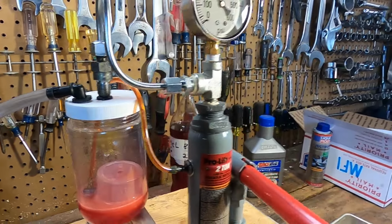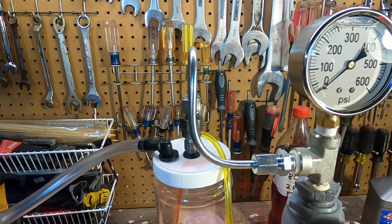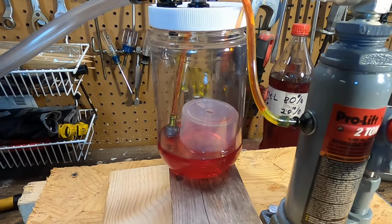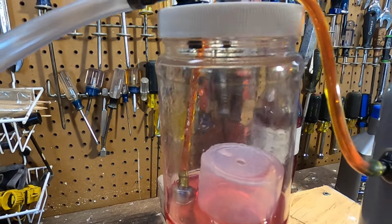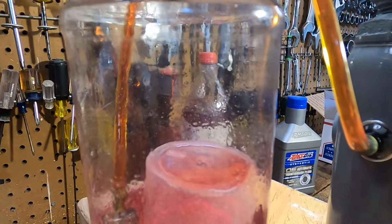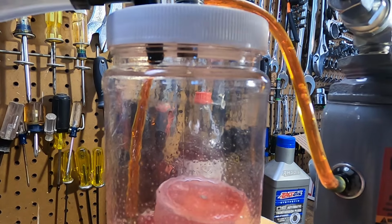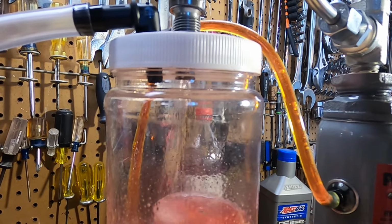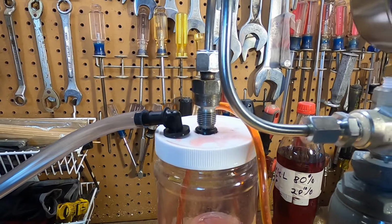This is how this looks compared to the others. That was just the first one. Second one we're going to be testing. We're starting off at 0. Pump it up slowly. Right now we're just pumping air, and there we go. Okay. That's another one that's not spraying right. Can you see it? It's not a spray per se, as it is a squirt. I will try to clean this one as well. Could be why it's been running so rich and gumming up the spark plugs.